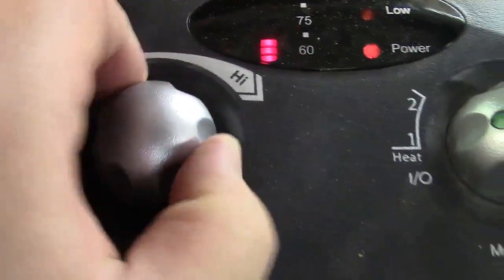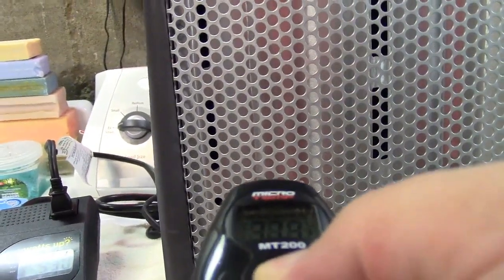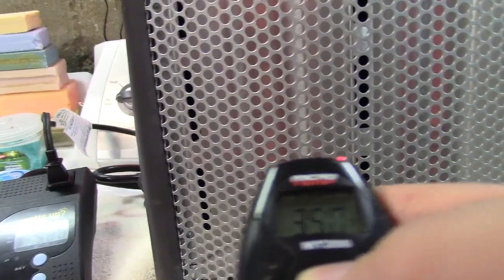It has a finite amount that it turns. It's certainly getting warm now. On low they actually do glow a little bit — it seems brighter and then gets dimmer, but I don't think the camera makes that out. It's certainly putting out some decent heat. Although it's bulky and tall, because you have that surface area it really throws the heat out pretty well. We're getting around 350 degrees and it's using 530 watts.